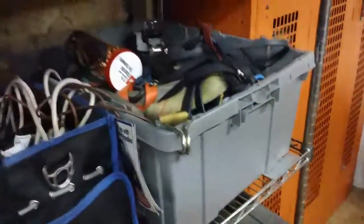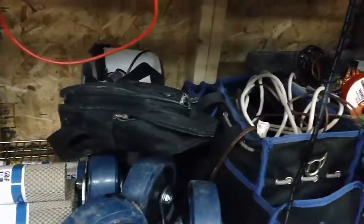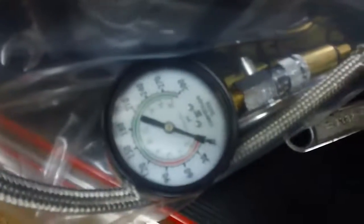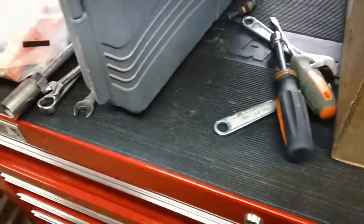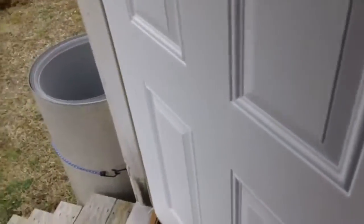Okay, it's Tommy. I got a new battery for the '65 - the one on it wasn't very good. I got some plugs and things for it, but I thought before I get started too fast on tuning it up, I want to do a compression test on a couple of cylinders just to get an overview of what it looks like. I noticed in my video that you're seeing some blow-by coming out of one of the valve covers, so if the compression's pathetic there's no sense in doing anything to it right now - just overhaul it if it needs to be. But I want to go ahead and check it out and see what kind of compression we've got.